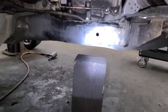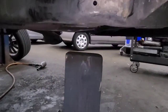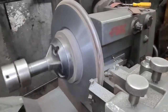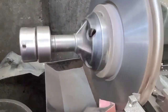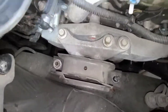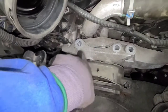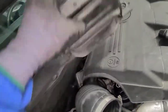Just get a big block of wood, then lower the car to where the engine is just sitting, and then remove the engine mount. This rotor is nice and clean — I'll give it a little buff with sandpaper on both sides. The two nuts on this side are 18s, and then the three are 15s. After removing all the bolts — two 18s and three 15s — the engine mount just lifts up. Now I need to remove this bracket — I believe these are 18s. There's a total of three bolts: one here, one over here, and a last one.